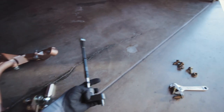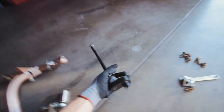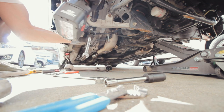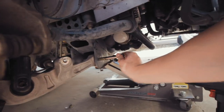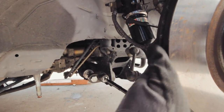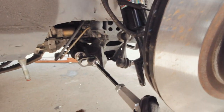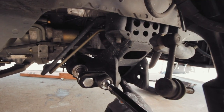Here's all the stuff I got. I already tightened this while it was on the car. It doesn't matter what side it is — it has to be facing the opposite way or else the subframe would be in the way. After I got the tie rod out it was pretty easy, just where the ball joint connects to the knuckle is pretty difficult. Now I have the offset rack spacer with the S14 tie rod. All the way in it should be perfect for the track width I'm at. Now grind down these nubs so that the arms can actually fit on.